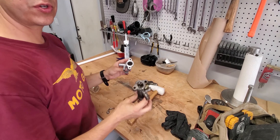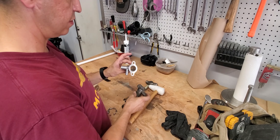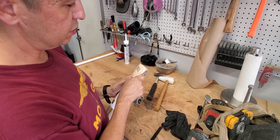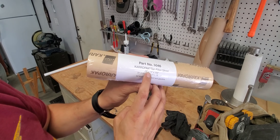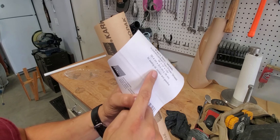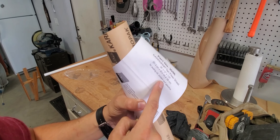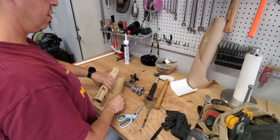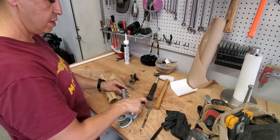Since the auto parts store gave me the wrong gasket, we're going to go ahead and make a gasket that fits on this part right here. There are multiple ways to do this — I'm going to use some gasket paper. You can see the part number there; I'll link that in the description. If you're going to make any gasket, you want to make sure it's rated for whatever type of fluid it's sealing out — in this case, it's coolant. Let's cut out a piece that's going to be similar in size.